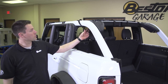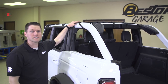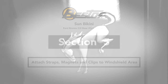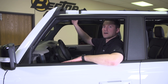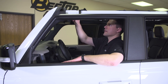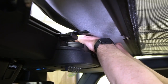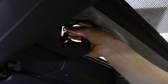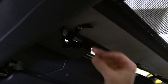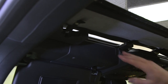Now that we've tightened both bolts and have both corner straps on, we're going to go ahead and snug this up a little bit — we don't want it too tight, just taking some slack out so the bikini top is held firm, then work our way to the front. At the front, there are small plastic hooks in the middle that we use to pull it tight, and then a strap on the outer that gets fed through the receiver and snapped into place. Get a finger on either side of the web strap, push it forward, and it locks in place. Feed the web strap down through the hole and it comes back up and snaps to itself. There are also two magnets on the outer corners that should find their home and give us a nice clean front edge.